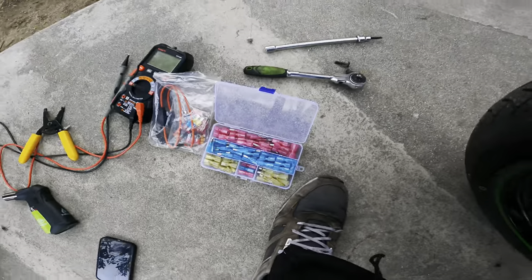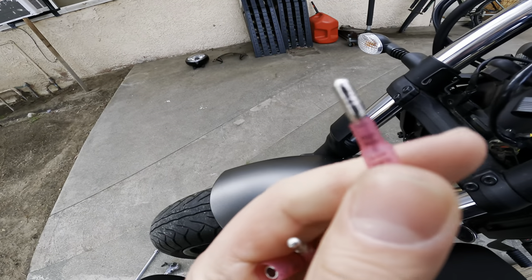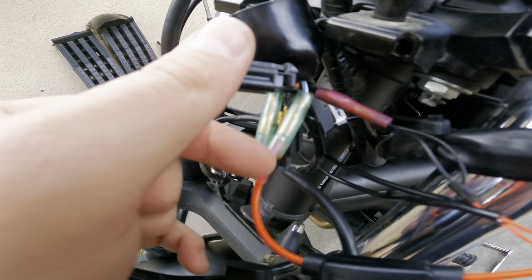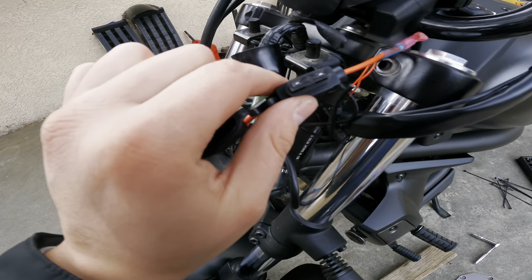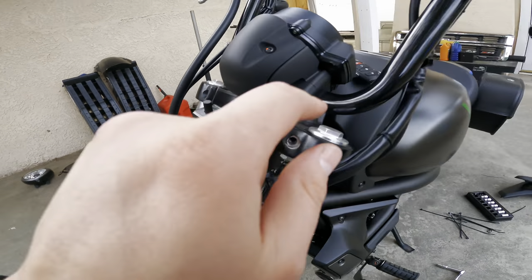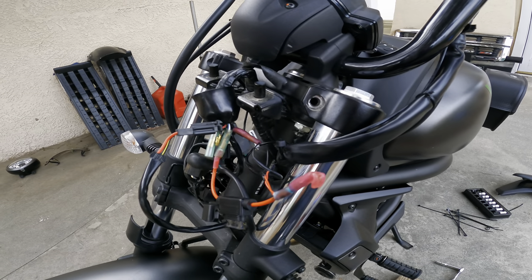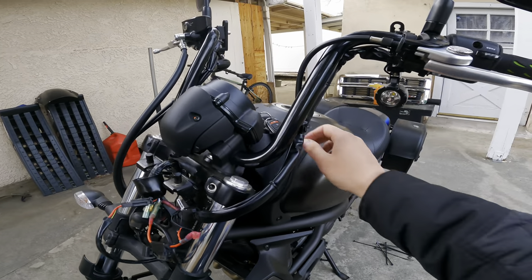Alright guys, we're almost done here. These are the connectors I was using — you pretty much just clip them on at the end and connect them together. That's how the Kawasaki wiring came, so I was trying to match it as best as I could, and they worked out really good. I added a two-amp fuse for both of the lights — I ran both of them together into the two-amp fuse because I don't think these lights are going to pull more than two amps, probably less than an amp. The owner's manual also says the maximum current draw should be no more than 25 watts or two amps, so you have to take that into consideration so it won't drain your battery. That's why I like these lights — they're really bright and they consume very little energy.